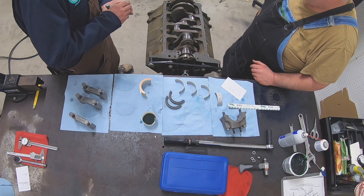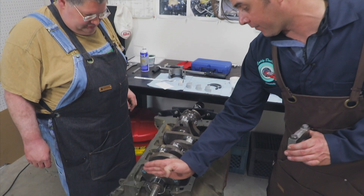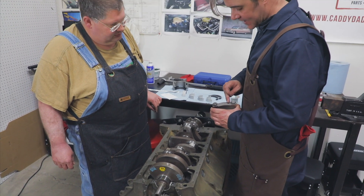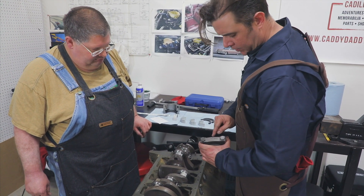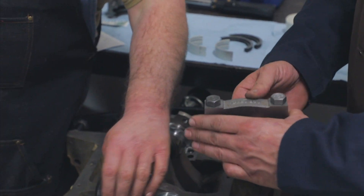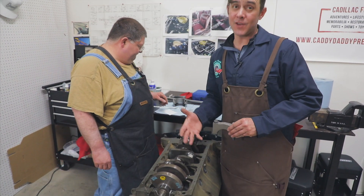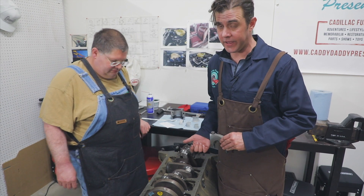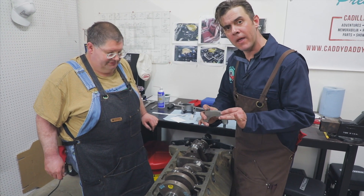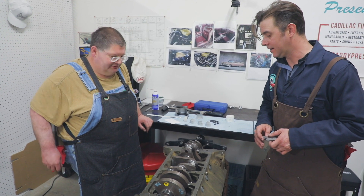On the Cadillac, our main caps are all stamped and numbered one through four, so we go from the front of the engine towards the back. On a 59-style engine like this, you'll see a casting number — the bottom of the number goes towards the rear of the block. It's a little thing to help you out because it looks like they'd want to go in either direction, but they don't. If you put them in the wrong direction it's a good way to hear a cracking sound and be in a heap of trouble.